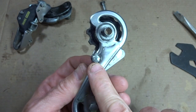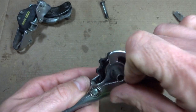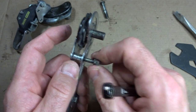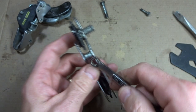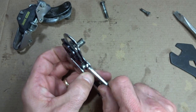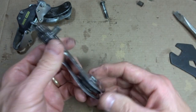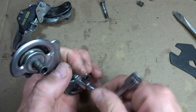There's a little screw here, and that's a 7mm. I can go ahead and loosen that, and once it's loose, go ahead and remove this screw. It looks like there's a little spacer in here, kind of just sitting there loose between those two cage plates like that. This is still kind of tight, so I'm going to remove this screw here for this pulley.